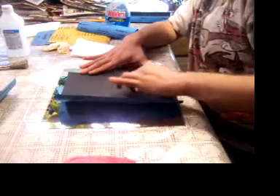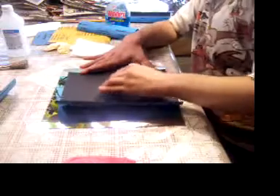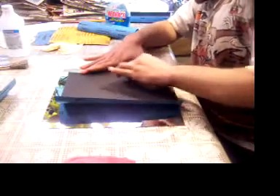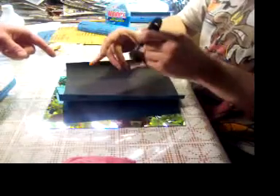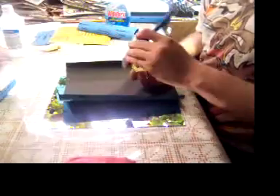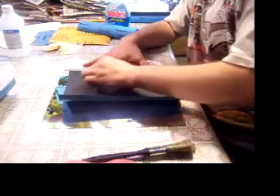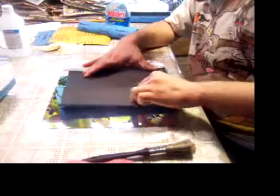Just the weight of your hand — if you need a little bit more pressure, add a little bit. Sorry folks, I'm left-handed so you're probably just seeing my knuckles. Periodically pull the CPU up and look at it. Take your paintbrush and dust off the facing, then flip it over and dust the backside — those are your pads, we'll get back to those after we're done lapping. If you need to close the sandpaper, do that. Add a little bit more pressure, wander around the whole paper, rotate counterclockwise and clockwise.